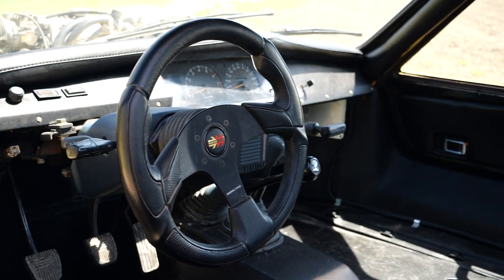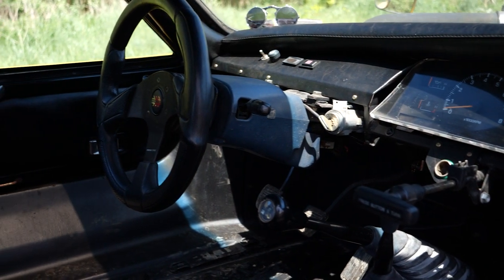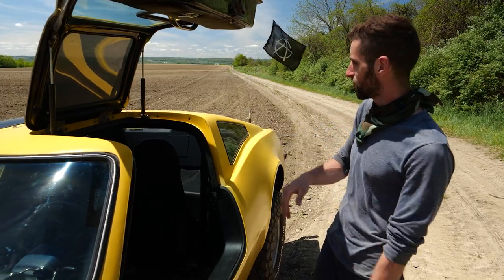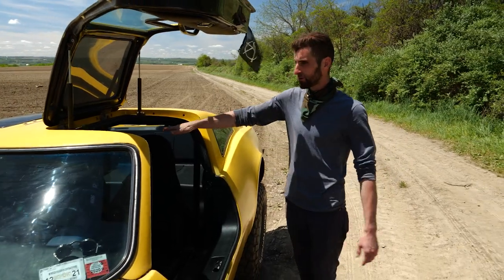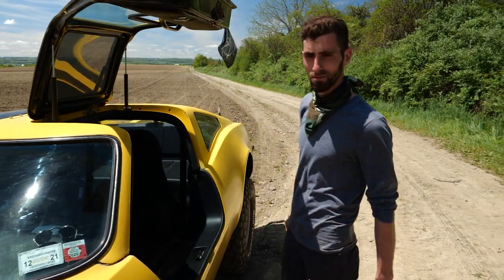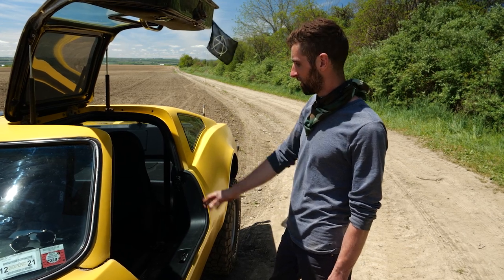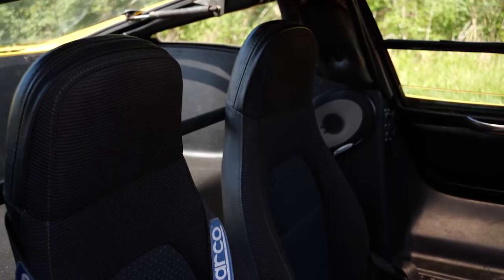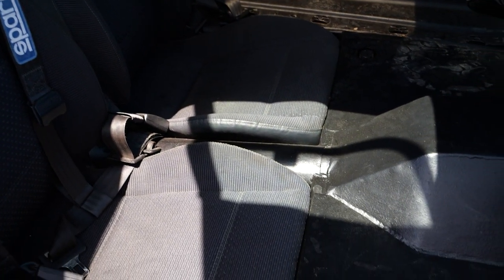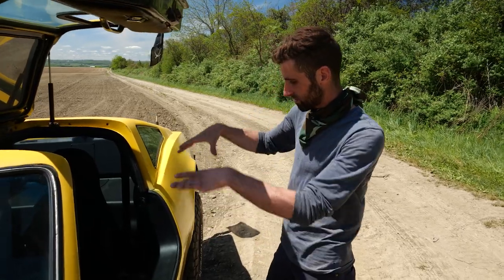Inside is pretty straightforward. You've got Toyota column, Momo steering wheel. I had to custom make this floor. There's a really unique driving position to this car because it's such a narrow body — your headroom is terrible. So to make it work, I wanted to run actual automotive seats to try to increase the comfort of the car. I took some Mazda Miata seats — they're pretty narrow and kind of a sports seat — so I notched them down into the floor and sort of tucked them in the frame.